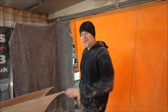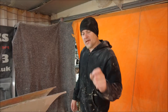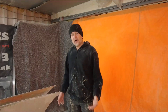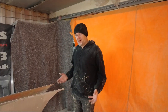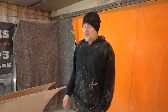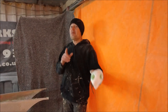For now, there is no easy and certainly no dust-free way around sorting this out. I'm just gonna have to get the angle grinder — I said I was gonna use double discs, but I'm gonna use a 1.5mm grinding disc. I'm gonna cut all this out, cut and cut and cut until this swings open, then it's gonna just be a load of mess, we'll put it all back together, and by the end of the day, hopefully it should be alright! Let's get the grinder and make literally a biblical amount of dust. Just before we get the angle grinder out, this is where I'm gonna cut.